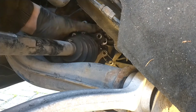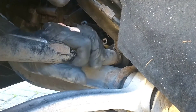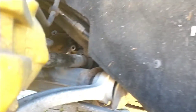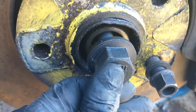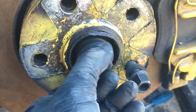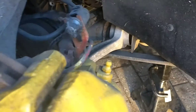Once one side of those bolts is free, we should be able to just grab it and move it to the side. Then we can come around to the front where we've wound out this bolt — we're going to push it all the way in just to push the driveshaft out. Now we're going to take that bolt out and around the back, and we should just be able to wiggle the driveshaft around.